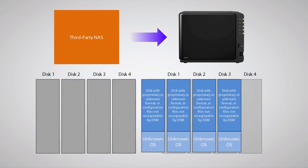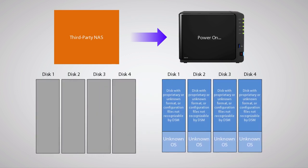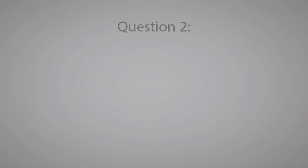The simple reason is that a Synology NAS will not mount or make available disks that it did not format internally. Your Synology NAS will also not mount disks that are formatted internally if they've been removed or ejected while the NAS is on. This isn't to say that it isn't technically possible to mount other disks, but the only supported way to do this would be with a USB dock for a non-RAID disk, providing the disk is in a compatible format.